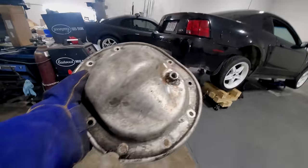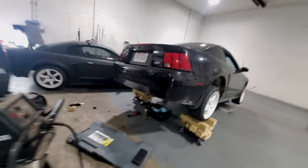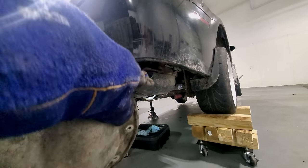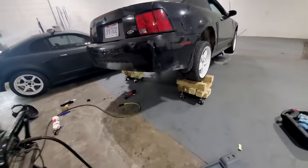What I typically do is weld a nut and put a bolt in there as a new fill port. The reason I do this on these straight axle cars is because if you live in the Midwest like I do — in the rust belt — the fill tube neck on the axle typically rusts in place, and when it seizes it's just a pain to get out. So instead of fighting with it, I drill a hole, weld a nut, and put a bolt in there as a plug.